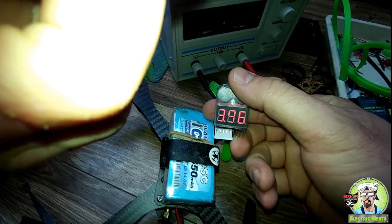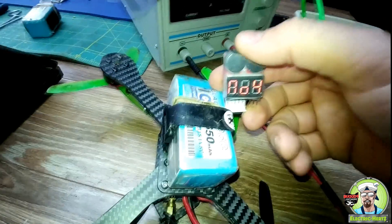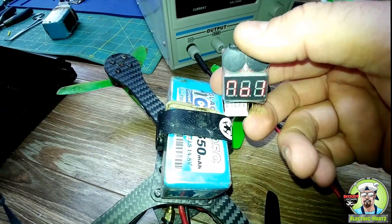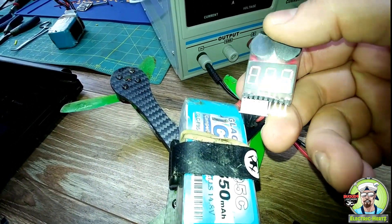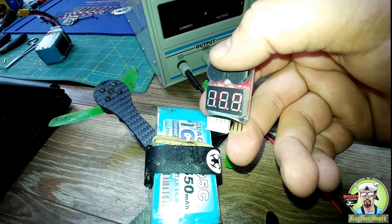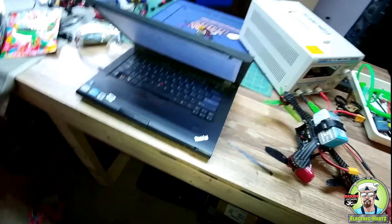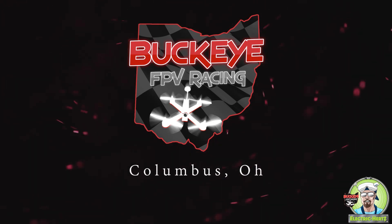15.9, 15.9 — I really don't see it being that far off. I mean, that wasn't horrible. Had a minute left, we drained maybe 50% of the pack — 50% of the usable pack. Not too bad. It's hard to see: 3.96 per cell, 3.98, 3.97. 5.15, 5.9 overall. So very good — later, thank you.